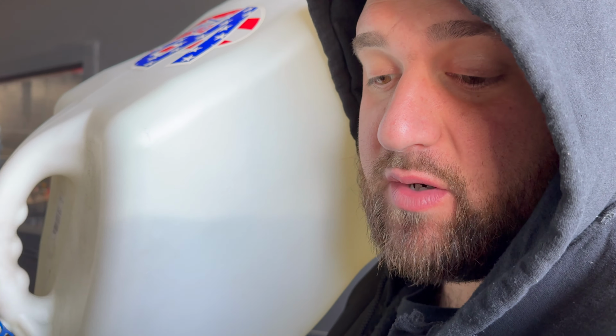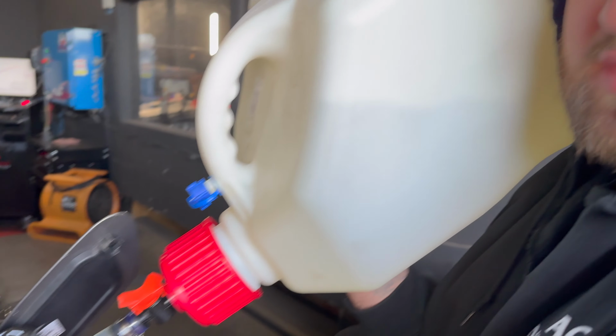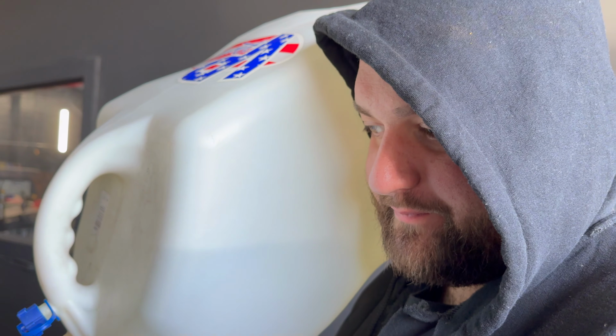Feel good. She did good on pump gas. She made 530 wheel on pump gas. So 530 wheel on pump gas, that's really nice. Probably a mid 10 second car in the quarter mile on pump gas. So that's really nice. And now we're about to add the E85. It'd be nice to be a 9 second car. Let's make it happen. Let's add the E85, get a dyno run, see what we do.